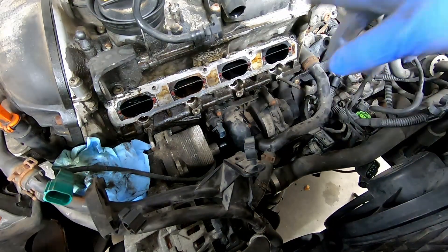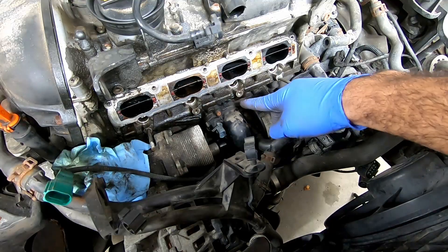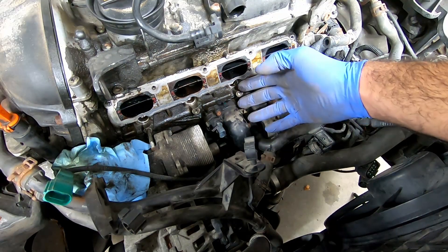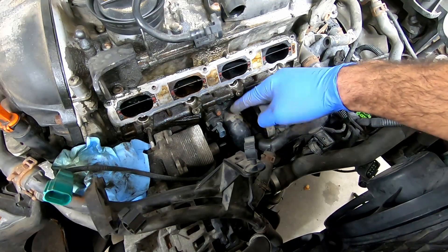The manifold's off. Things are very dirty, but most two-liter turbos are pretty messy. Let's get the water pump out of here. Clearly the water is coming out from behind here — you can see it bubbling. We do have a gasket here; it's possible the gasket has gone bad. But this is all plastic housing, so let's take this off and see what's causing the coolant leak.